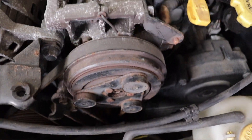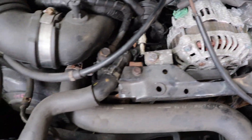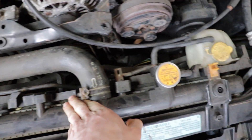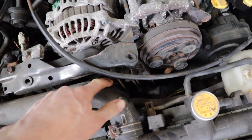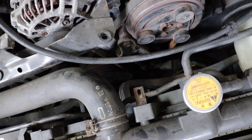I don't think we're going to have to pull the AC or the alternator — I think I'll be able to wiggle the front cover out without it. But I do have to get the top hose off, the fans are going to have to come off, the washer bottle, and obviously the belt and the tensioner. We will have to pull the front crank pulley off to get the front cover.